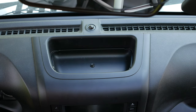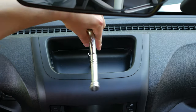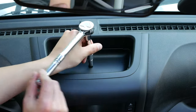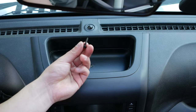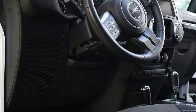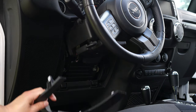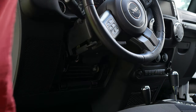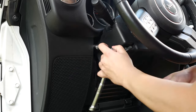Next step is to go to the little tray on the top of your Wrangler, take that out, and there's going to be a little bolt — remove that and stick it in the cup holder. Then you want to expose the two bolts that hold the dash in place. Grab this spot and pull down on both sides of the steering wheel. It comes out pretty easily — stick it in the back. This will uncover two bolts, one on the left side and the other on the right side of the steering wheel. Get your 7mm and get those bolts out.